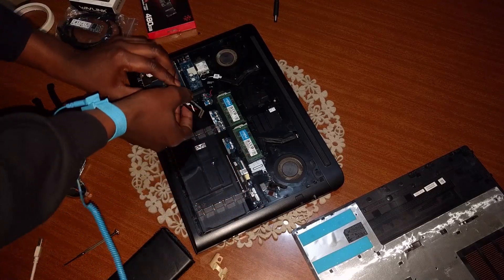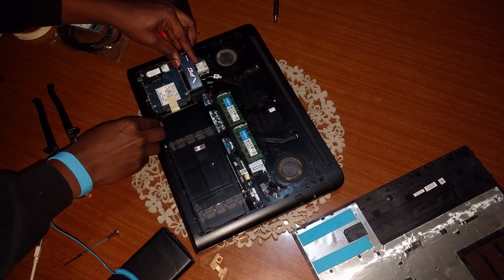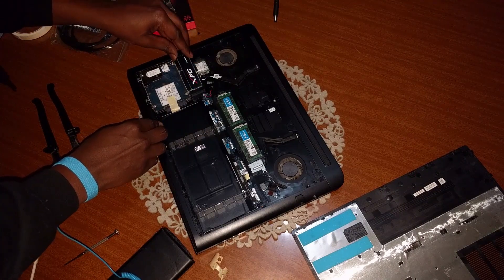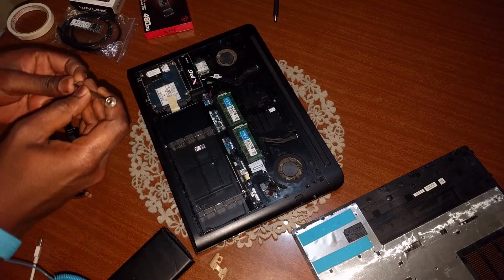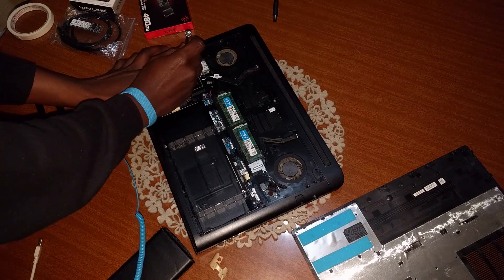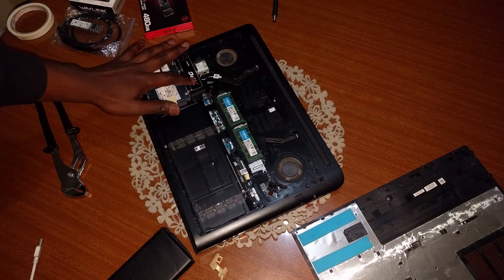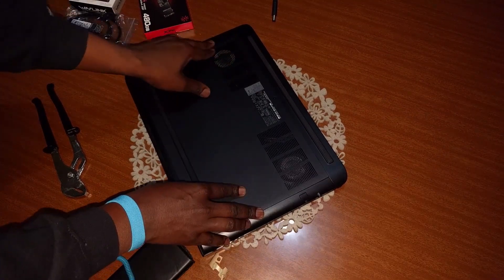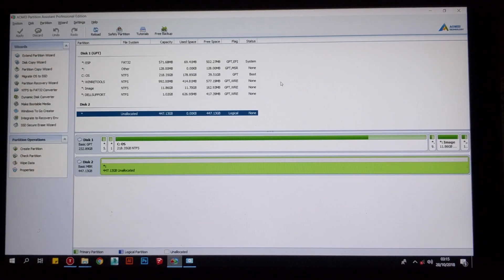Make sure you leave the temporary drive installed, as the disk will contain the data needed to port over to the NVMe drive. Close the lid and boot up the system once again. The system should boot up from the temporary drive installed in the previous step. Once the system boots up, go into the partitioning and formatting application where you will need to format the NVMe drive and convert it from an MBR disk into a GPT disk, as earlier done for the temporary drive.